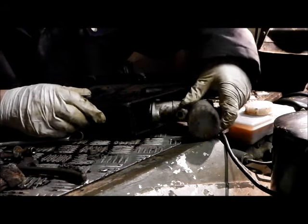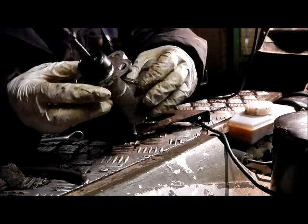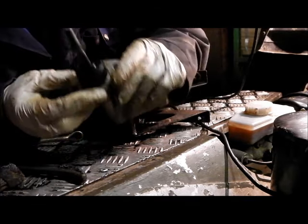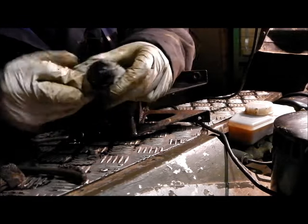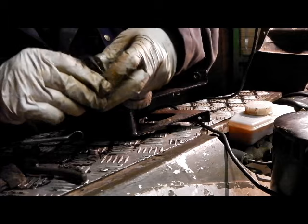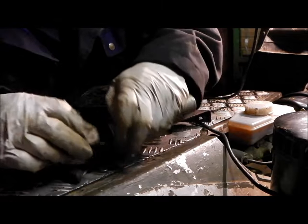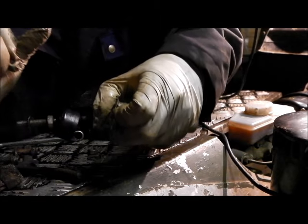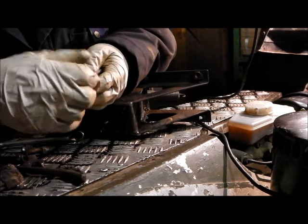Having removed the nut from the end of the link rod, you can withdraw the master cylinder. You'll see this one's got a shim on there, so we'll keep that and make sure that goes back with the new one. You can see quite clearly that it's been leaking. I'd expect if we pulled the dust cover off it would probably be quite bad in there - it's pretty oily and the dust cover itself is full of fluid. So don't lose the nuts; you'll want to reuse them on the next one.